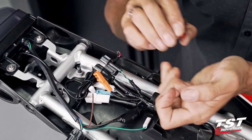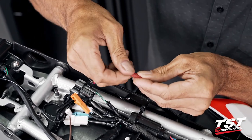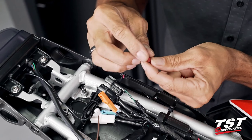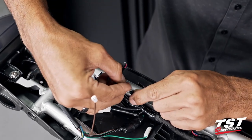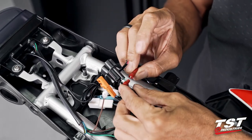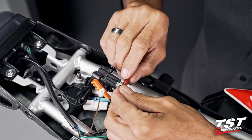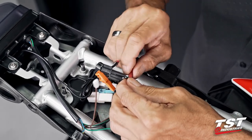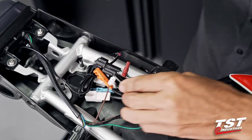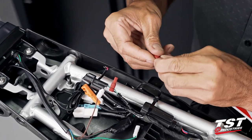I'm gonna grab the larger diameter cap from the connector, unscrew it, and expose the slit that you pass the wire that you're connecting into through. Get the rest of that connector seated down. There's a small piercing element protruding from this side of the cap that makes that connection. Repeat the procedure on the other wire.